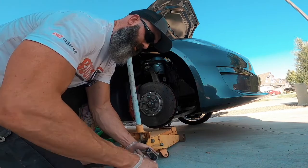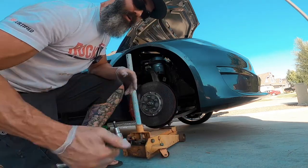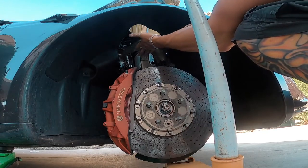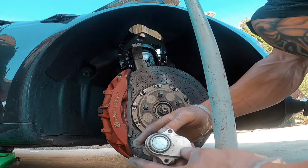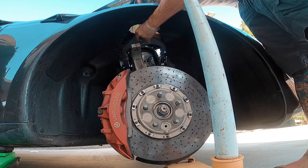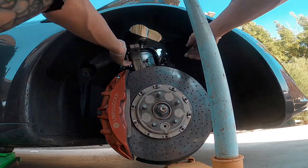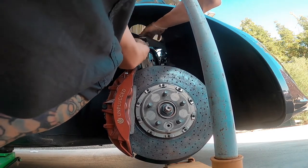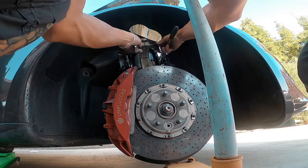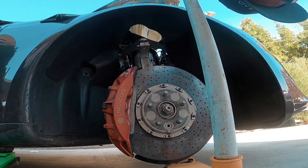This is gonna take a little bit longer because I'm doing some explanation, but we're at two minutes and 30 seconds. T50 and the 15mm — that's out. Now I'll take the top little pill off with the two Allens. Take these two little Allens out gently, lift the top, rotate the pill to the street setting instead of the track setting. This is gonna bring the camber out two degrees. Tighten it back down. Sometimes popping this back in is smooth, sometimes it's a nightmare — with the jack under there it really helps. Tighten the nut side and hold it on the T50 side. Seven minutes in.